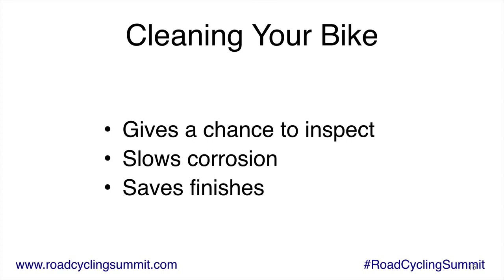It doesn't take a lot of time. It doesn't have to take a lot of time. You can go crazy and keep your bike spotless, but it's not really that necessary. But what's really important to me, especially with some of the modern high-tech carbon fiber bikes, is they can get cracks, okay, from crashing or whatever. And sometimes they're really small, and it takes a while for them to get big. And if you don't clean your bike, you're never going to see those cracks.